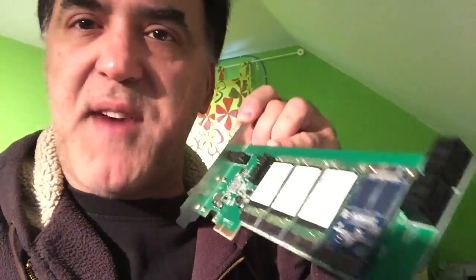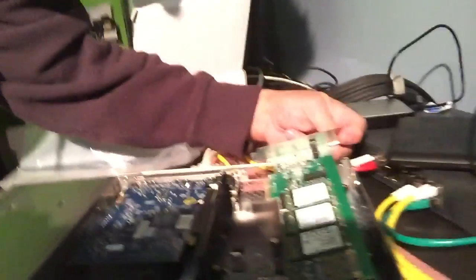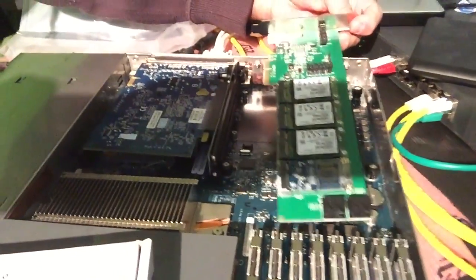It's pretty nice and it really accelerates everything. Booting with this card and having all your applications on here, they fire up really fast, and your data can live on a separate hard drive. This is just an update on the project and what I've been working with — it's working really well. I hope it gives you an idea that you can really breathe a lot of life into this machine. If I had less memory — this is fully populated at 32 gigs — you could configure the memory to have room to plug in some SATA drives as well.